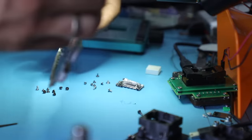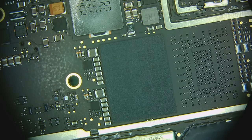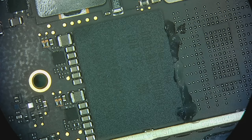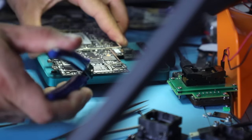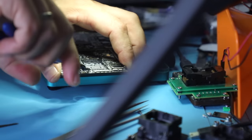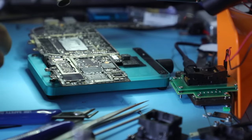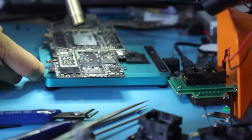So this is a Surface Pro 5 — sometimes with one chip, sometimes two. Put that in the vice right there and let's have a look-see. If this was liquid damage that would be a good problem to have, but things look good here. To remove it I use JBC hot air, but I removed the nozzle completely — I just leave the fully open air for it and will apply some flux. Fume extraction is on.